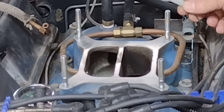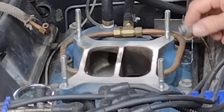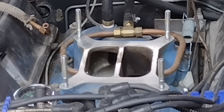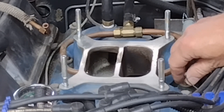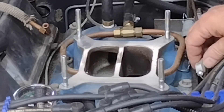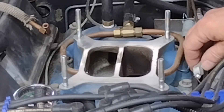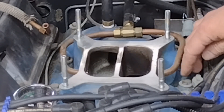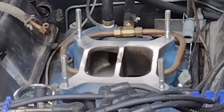And if you're looking really close, you'll see this — that's a kickdown cable. It controls the Ford 4-speed automatic transmission currently in this car. This is a 1967 Mustang, it's the original 289 engine. If you have an old car and you want to put in a mid-80s overdrive automatic, you need the cable. But we won't be going into that because that's an incredible story on its own.